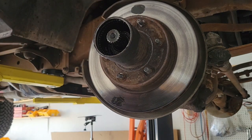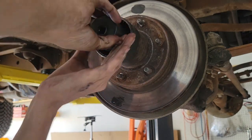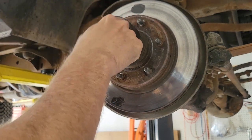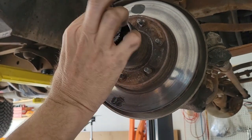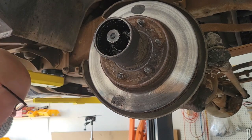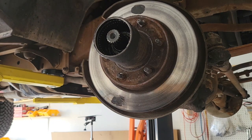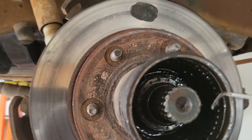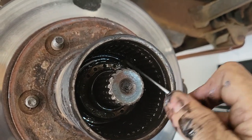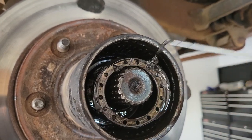It's easy — you just stick it in there and unscrew it. It's just a simple little nut with the four tangs on it. Again, putting everything in order on my workbench. Then there should be a thrust washer in there — I'll pick that out. And there should be another nut on the inside and that's what sets the preload.